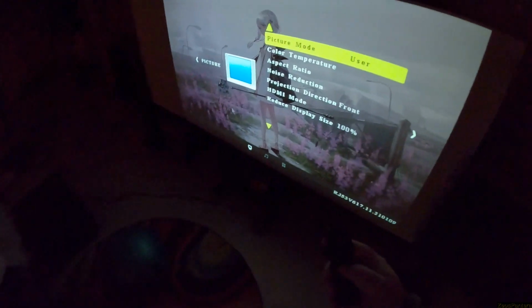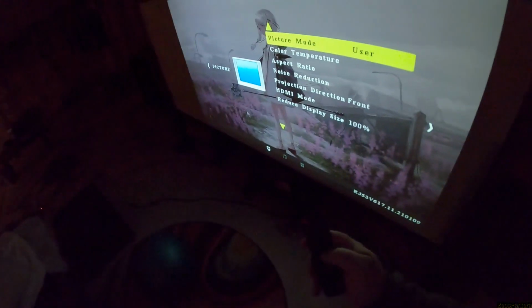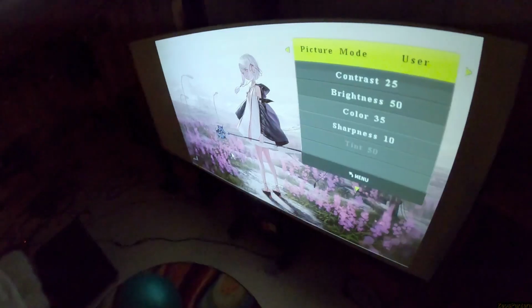This will probably vary. A lot of people don't understand that when you plug in a projector or a TV or anything, your source has voltage. This laptop has a certain voltage it's outputting for red, green, and blue, and the projector itself and the screen material are all going to be different, including variations in the color tone of the LED they're using. So don't go, oh, I put these numbers in and it still doesn't look right. Find the numbers for you.